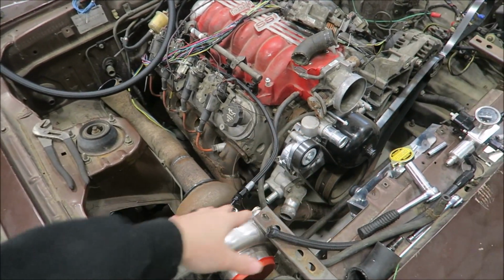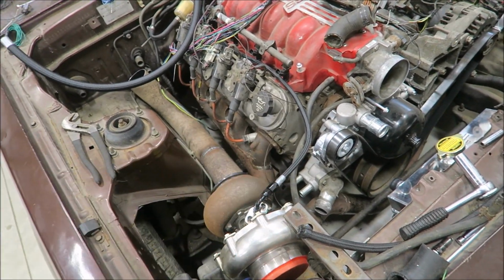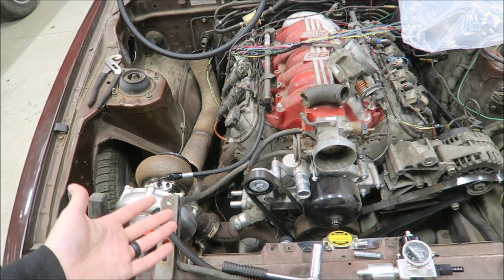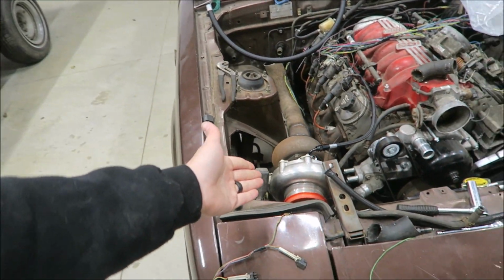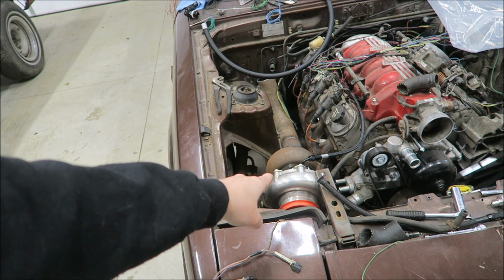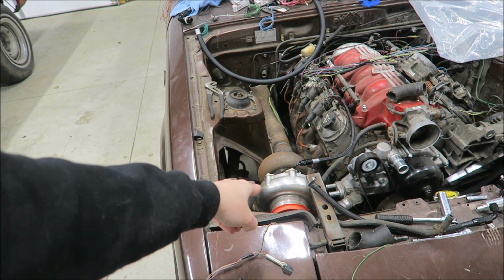And then the turbo kit, I just flipped the manifolds, ordered some 2.5-inch pipe and some V-bands, made that all myself. I've got 30 bucks into that. The turbo is just a China eBay 7875. It's not even the VS Racing one. I went cheaper than that. That was, God, how much was that? I think that was 240 bucks, maybe.